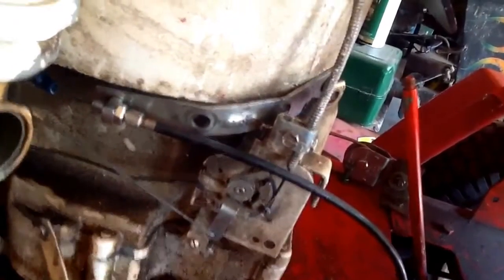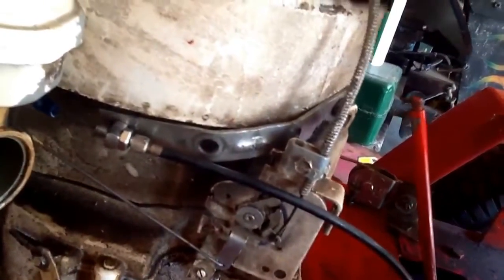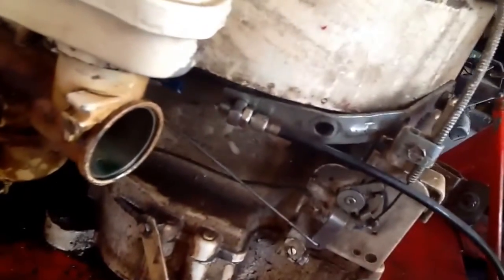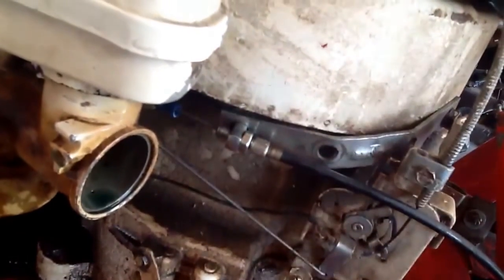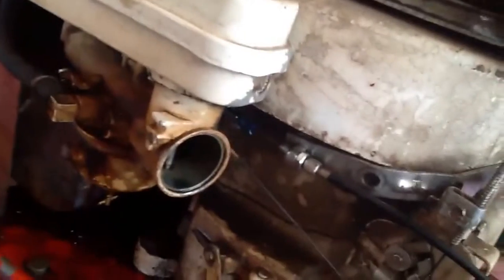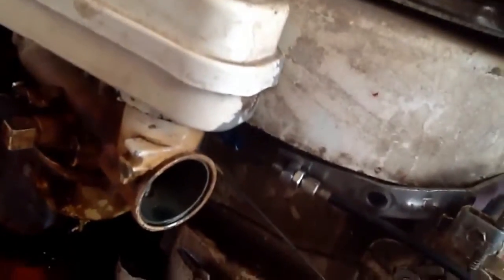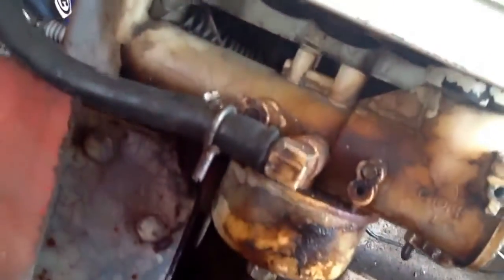And I just took an angle bracket from like a wall shelf hanger, bent it on there and notched it to fit around the motor. And then I took a bicycle holder for the brake cable and put it in there. And then behind there I put another wire connector that goes onto the stock linkage. And I got my spring there. I gotta put another one on there.